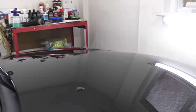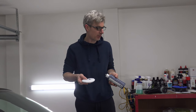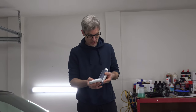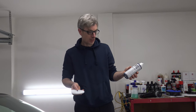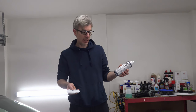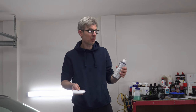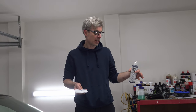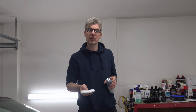We've made some improvements. Like I say, because the paint is so good on the car, what we're going to do is seal it using a glaze and then put a wax on it. The first stage of the process is we're going to use something called Black Hole, which is a glaze. It'll help the wax bond to the paintwork a bit better and give it a slightly deeper shine. This particular product also has fillers built into it, so it will actually mask any micro-imperfections. Because we haven't machine polished the car today, this will hopefully help the finish and the end result.